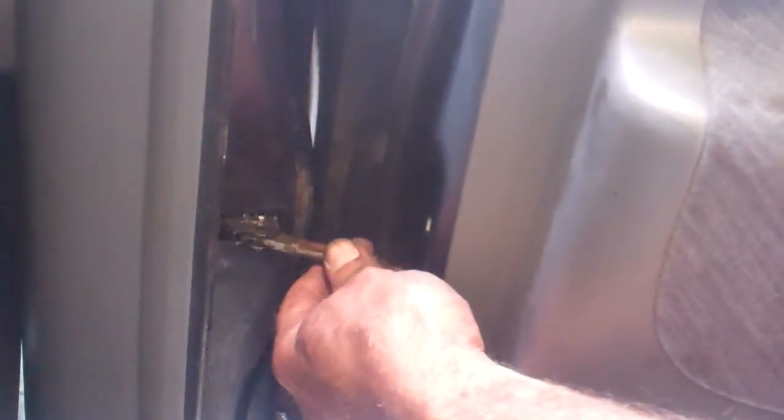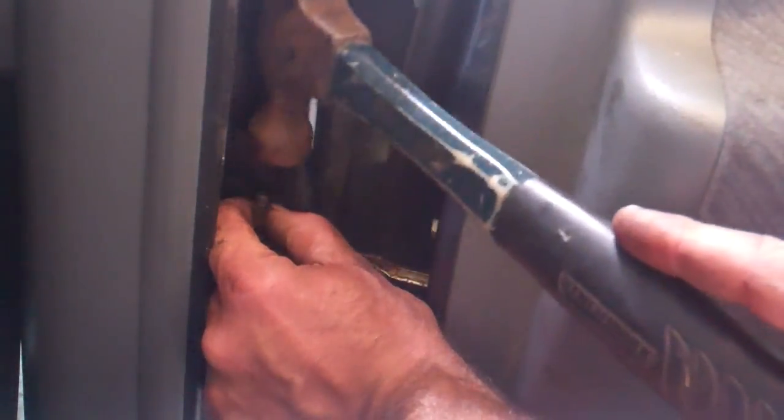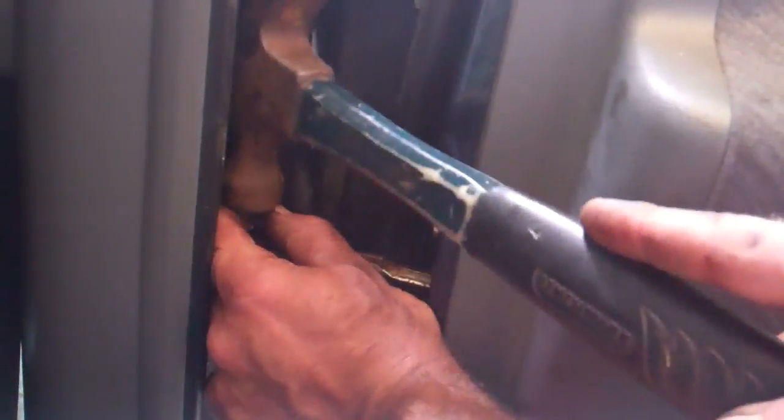Now I'm going to get that door pin in place. So I just move the door till the hole in that hinge lines up. Place that. Get that lined up relatively straight. Take my hammer, get that little top. I have to lube that up there with some graphite or something. I'll spray at the moment.